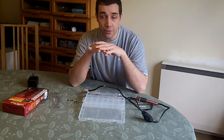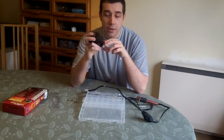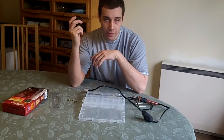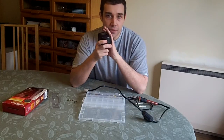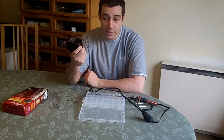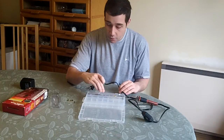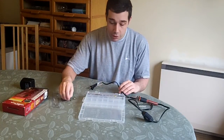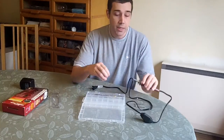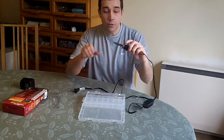These transformers have their rating clearly displayed when you purchase them. You need one that copes with at least 25 watts — there's nothing wrong with having one that copes with more wattage. This one I'm using is a 45 watt transformer, which has no problem dealing with the 25 watt machine, and it converts 240 volt to 120 volt. So if you're in a country that doesn't use the same voltage, you really do have to buy a transformer — also known as a current converter — rather than just an adapter.